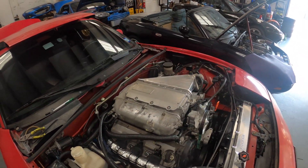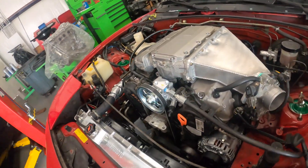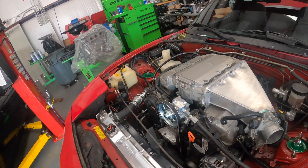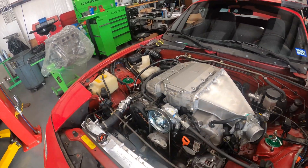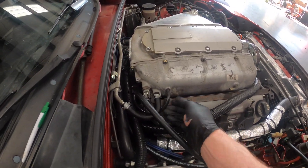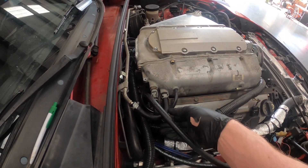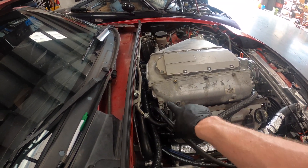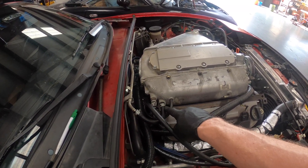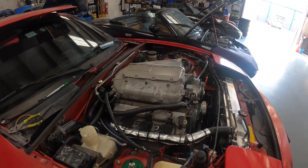The intake manifold has now made it onto the engine and everything is torqued down appropriately. I did the clearance cut I mentioned using my non-ferrous aluminum bit — cut it down just enough to fit, though unfortunately it didn't go all the way through the weld. I connected that over here. I also put a hose on here for the vacuum reference for the pressure regulator. The OEM hose didn't work because it's a different size at the cut end, so I have another fuel line on here with all new gaskets on everything intake-manifold related.